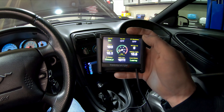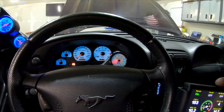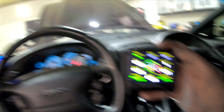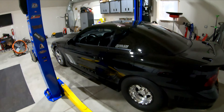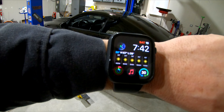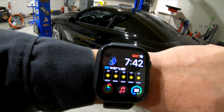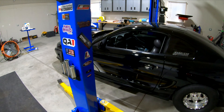There's a flaw in the Terminator X when you convert it to E85 — in the drop-down window the whole fueling map goes lean, and that was my issue. I had to convert the drop-down back to gasoline and basically all the base fuel tables went back to normal when it got up to temperature. My good friend Billy Barnhouse told me about it — he's got a Holley system and is a dealer for them. He said change it back to gasoline and see if that makes a difference, and sure enough it did.